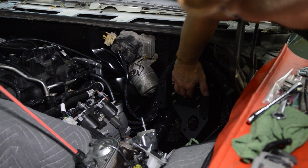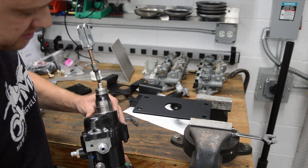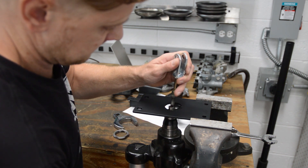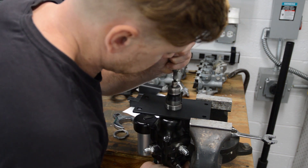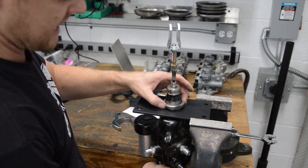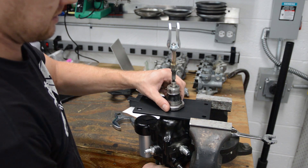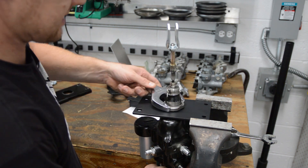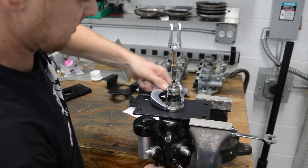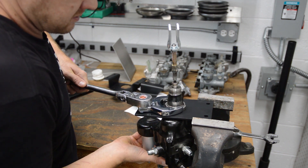The flat plate goes here and it's pretty simple. With the plate mounted in a vise and the Hydra Booster in hand, there's a slot that lines up with the key — put that in there, and then the large nut goes over it. This is where that special socket comes in with other designs, but I'm not paying a hundred dollars for a socket. I'm using a one and seven-eighths crow foot — cheapest option to do this. Use your half-inch ratchet and tighten it down and torque it to spec.